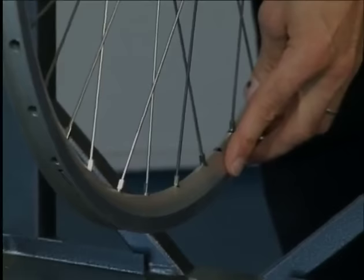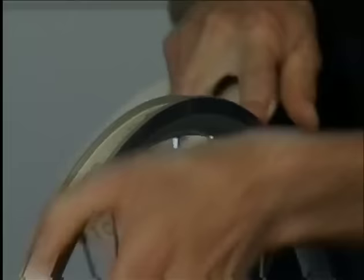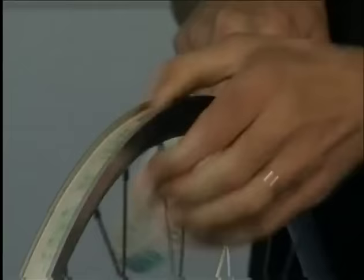Track clinchers are pumped up to 140 to 180 psi. Two layers of rim tape are used so the tire does not pull off from the rim, and so that the increased pressure does not cause the tube to wear a hole through the rim tape. With the awl, we punch a hole through the rim tape for the valve.